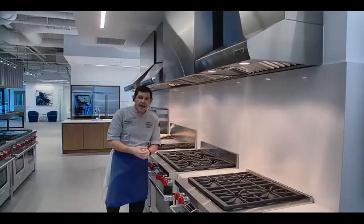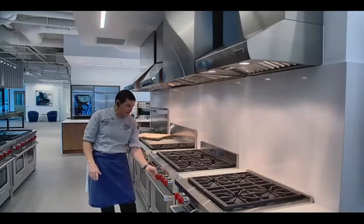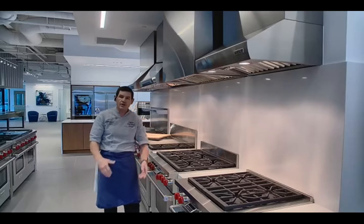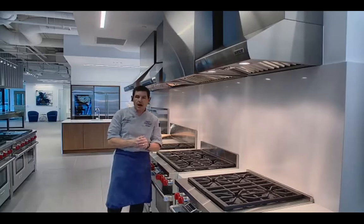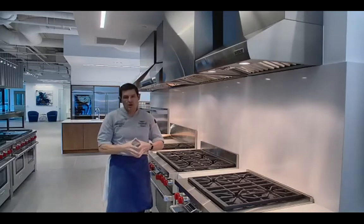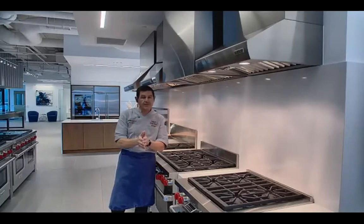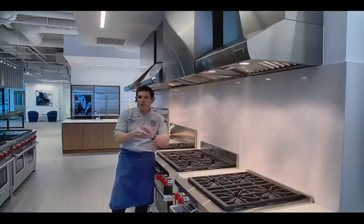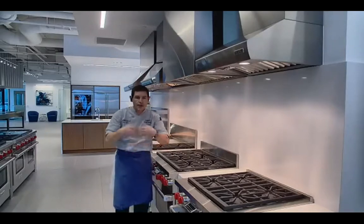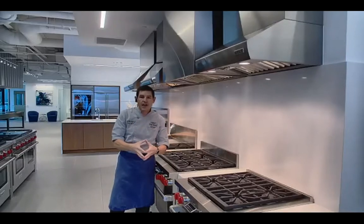Dehydration mode is accessed in exactly the same way, except that when we set the oven to convection and then take it all the way down to the bottom of that heating range and then flip it one more time, you're now in the dehydration mode. Dehydration mode has a nice range of 125 to 185 degrees, but the real important part about dehydration mode is that the fan will never turn off throughout the cycle, whether the door is open or closed. The fan will be running.